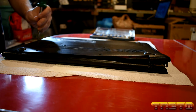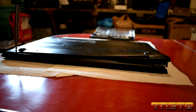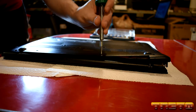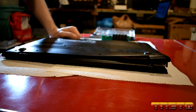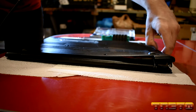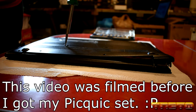We're also going to take the optical drive out because sometimes that will impede on the bottom case. Since this is missing screws, that'll make it a lot harder to repair. We're going to have to prioritize where screws go — usually you want them on the edges, especially supporting the hinge. I might take a center screw and use it on the corner edges to give that support back. I also see a lot of dust buildup, so we'll clean that out as well. I really need to get a magnetic screwdriver or a screw magnetizer.